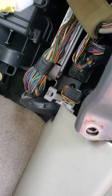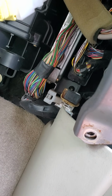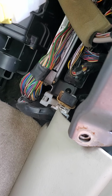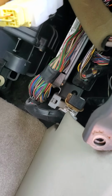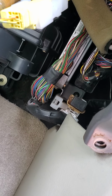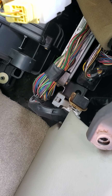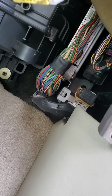There's 2 of them on the engine. So what I'm going to try to do is just splice those 2 wires together. I'll cut the black one off that comes in from the sensor. That's the bad sensor. The clear one is the good sensor, supposedly. And let me get this prepared.